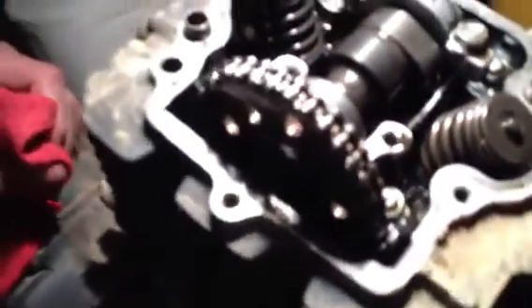I don't see any play in that valve. There's no play in that valve either. We'll have to take the springs off to find out if the valve guides are worn out. The springs are really tight — this thing is made for high RPM. It's moving though. Really tight springs. It looks like it's fairly new, because I see some shiny blue in there. Maybe the person before us redid it. So I guess it really is the rings that are bad, because it looks like the valves are fine. The cam looks alright too — doesn't look like it's scored or anything. Yeah, it looks clean in there, really nice.